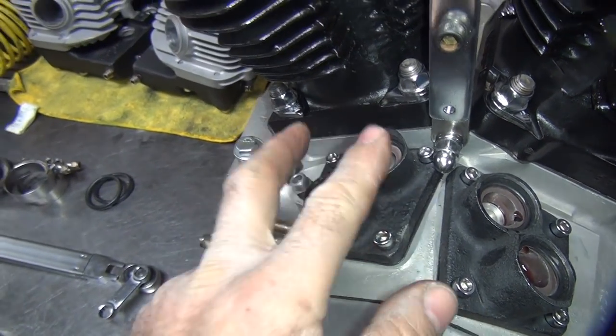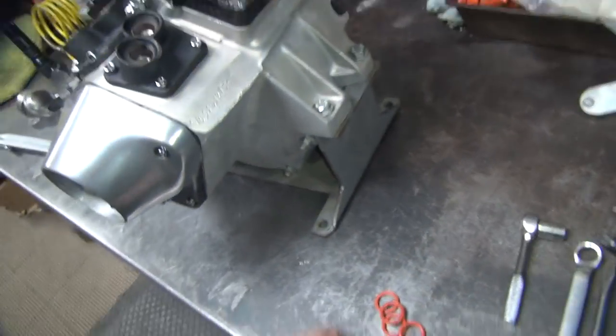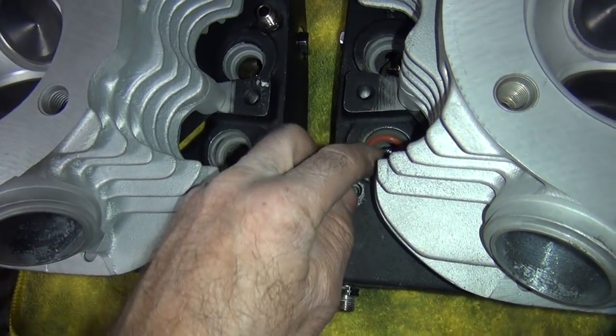These are not moving, so they're all the way down. This is when you adjust both of these valves right now — because I want the valves closed when this thing fires. I don't care about any other time. When the piston fires I want the valves closed, so I adjust them right there. If you adjust these two over here right now, both are open and you're in the wrong spot — it'll make all kinds of noise. Make sure these o-rings are in there.